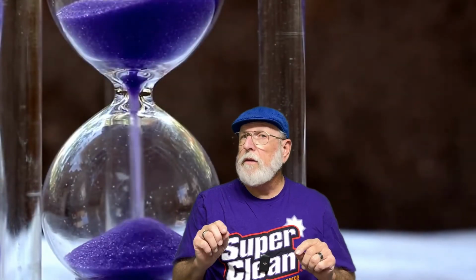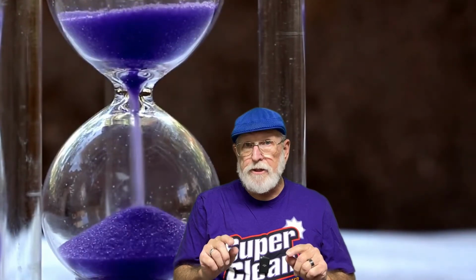So this really was a quick and easy repair. The longest part of the project actually is melting the ABS. And I just did that overnight. If you know you're going to do it a day or two in advance, it'll be done by the time you get ready for it. The other part was probably trying to actually get everything on the camera. Other than that, this was a simple project, and it's going to be permanent because the ABS actually melts into the pipe, becomes one piece. Contour it as much or as little as you want.